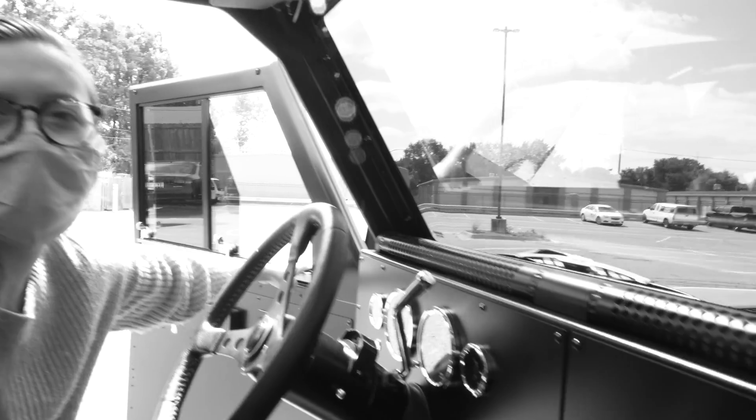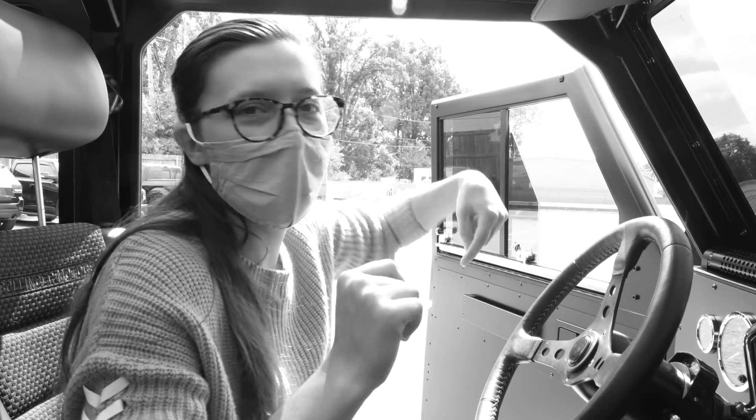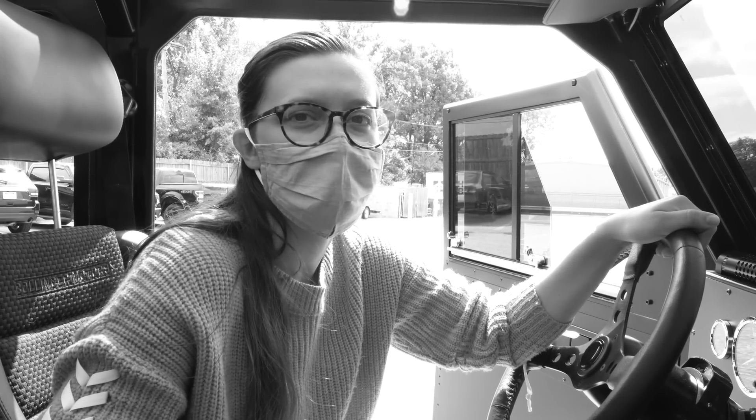Eric, it's coasting — I can run this whole track in like 45 seconds and I don't touch the accelerator at all. It's set up to be like an automatic transmission where you let off the throttle, or let off the brake and it has some creep torque on it. It shouldn't be burning energy while you're not moving, but once you start moving, it starts ramping in.